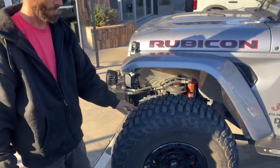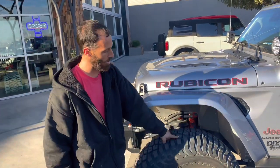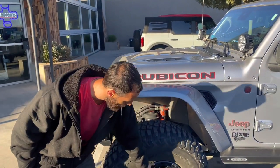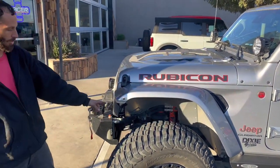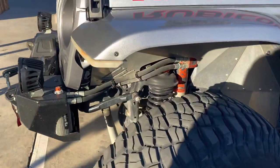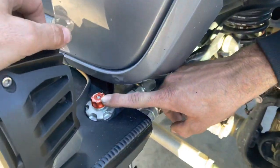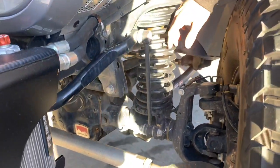This is a 39-inch tall tire. You could put a 40 on it, but we went 39 because you're driving it on the highway and towing behind an RV. Within that 17-inch wheel we had to do a little deeper offset to help clear the steering. It's a 3.5-inch TeraFlex long arm in the front with Fox 3.0 shocks — these have a really big reservoir and a dual-speed adjuster so you can adjust low speed and high speed of the shock, not vehicle speed but shock speed.